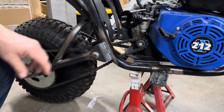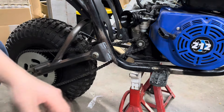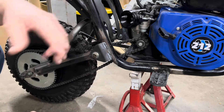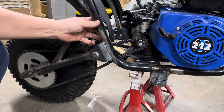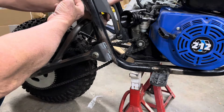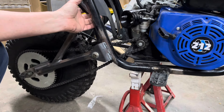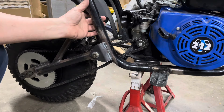I've got to get some springs for the foot pegs — that's a little harder than you'd think to find the correct ones since these did not come with springs. I've also got to get the proper pins instead of these bolts just dropped in there. I made an exhaust for it the other day — when I took it out for the ride it worked just fine, but I've got to wrap the pipe. Now that I've got the frame welded, I can go ahead and get things painted. I need to sort out the fender — I think I'm going to leave it where the shock goes through the fender like that, and add a little extra rubber down here to keep mud off the engine.